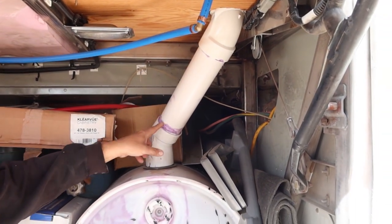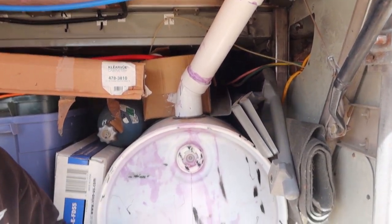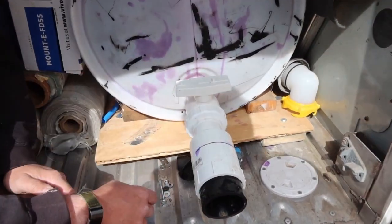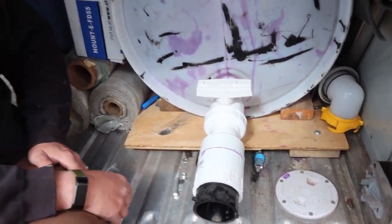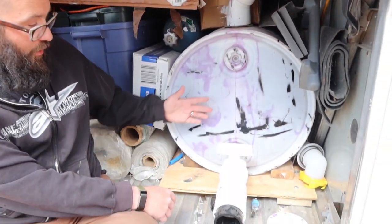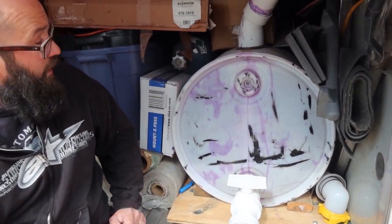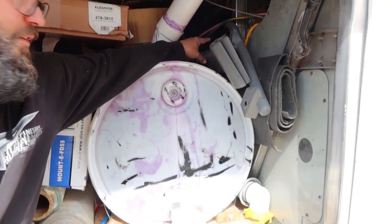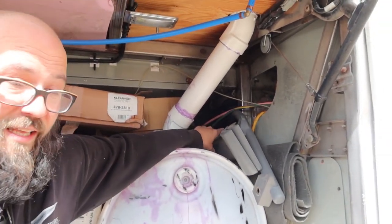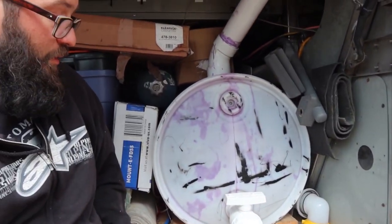But either way, here is the plumbing. It comes down from the toilet — 22-and-a-half degree bend and a second 22-and-a-half degree bend right into it. I wish I could have moved the whole barrel farther forward, but with the valving I could get, this was as short as I could get it with all the adapters. I really wanted a 3-inch valve so this could have screwed right into it. It's bolted through the floor of the bus in four places. There's an area back behind here that used to have the over-the-road AC — I think that's where I'd like the black tank in the future, but for now this will work.